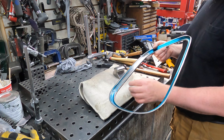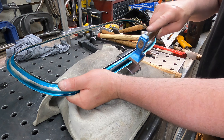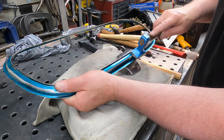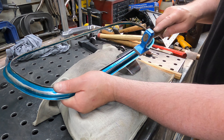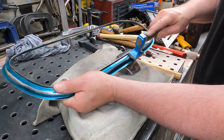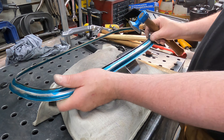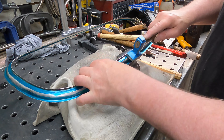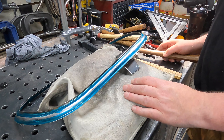It's always getting the last percent that's terrible. Finger on the back of the hammer — we're not driving nails. You can actually see it on the back side, because as you're hitting the highs they're going to shine up. These square-edged hammers are really handy as I can work right into that edge carefully.